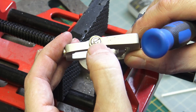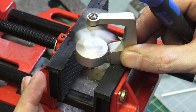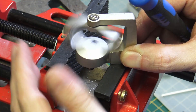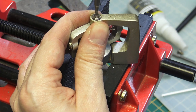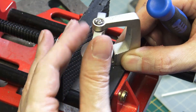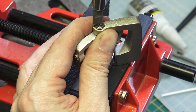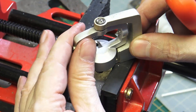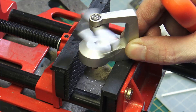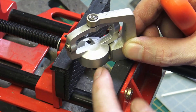Looking at the top, you can see there is the outer section, which is the lock, and the inner part that we adjust. That's looking really good — there's still no play at all. I'm going to loosen it off a tiny bit more, because when we turn the locking nut it removes it anyway. That feels really good — there's still no movement. And as you can see, it's spinning really, really freely now. So now that everything is feeling good, I'm just going to lock that top part down. Let's give it a spin — it's spinning really, really freely, which is excellent. That's what we want. And I can't feel any play or movement in the bearing while it's spinning. So I think this one should be good.